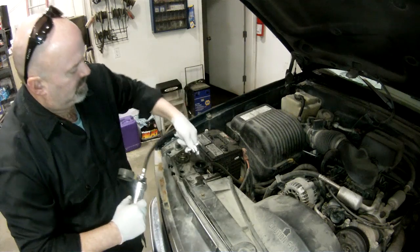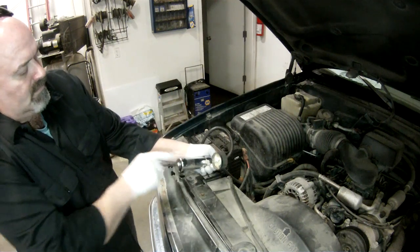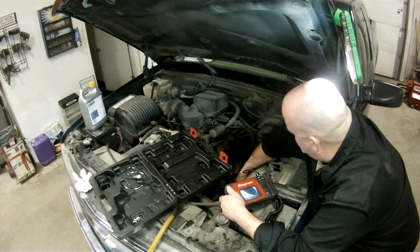The next step: I cranked the engine to see if there was any excessive coolant coming out of one given cylinder, indicating a cracked cylinder head or blown head gasket. I was also concerned about the possibility of an internal intake manifold gasket leak, but that wouldn't typically enter a cylinder — they typically blow out on the ends of the coolant passages on the intake. It was a little perplexing; I was thinking it was probably a cylinder head gasket or cracked head situation.